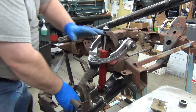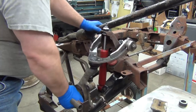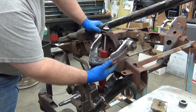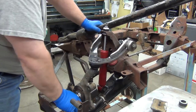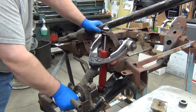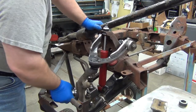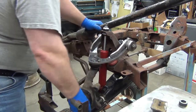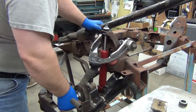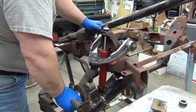Okay, this is the stock ride height setup. You know, it's going to sit about there. So I did verify that I do have to have the spacing in the bump stop. I do need it to stop here. If it goes down another ½ inch, the tie rods bind. Okay, considering the fact that that's only at full droop, there really shouldn't be an issue, because most of the time it's going to be up here, so you know it's not even close to the tie rods binding.